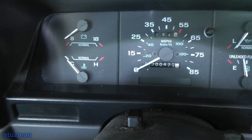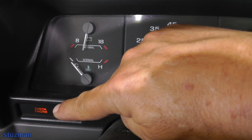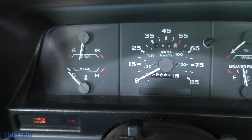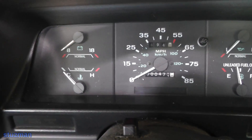If I turn on the switch - as you can see, there's our check engine light coming on. So now we know that fuse is good. We don't have to waste time on that step. Just by turning on a switch we've already confirmed the fuse.